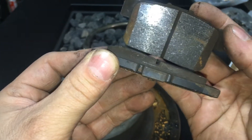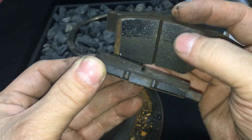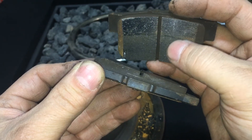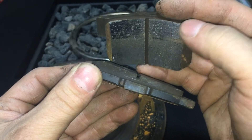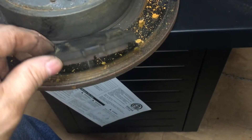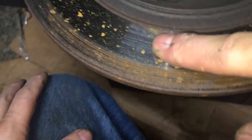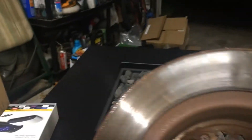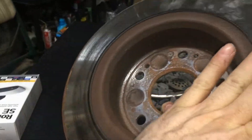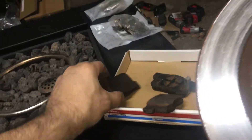This was the opposite brake. Notice there's a line up here — it's shaved here and up here it doesn't look used. This was the pad on this side, and you can see the pad was not touching up here, so it was only clamping down here.